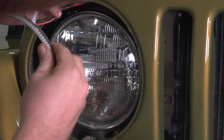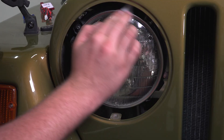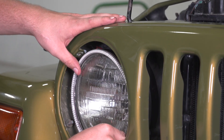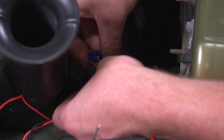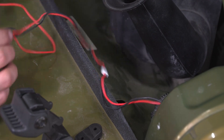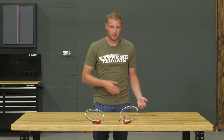The first step in getting the light installed on your headlight is going to be feeding the wires underneath the headlight bucket, cleaning off the outside of the headlight, peeling the 3M backing, and just giving this a push to stick it onto the light. Once this is attached onto the front of your headlight, then you can go ahead and get it wired up. You can plug the LED driver into the halo itself — there's a little connector there that you can use.